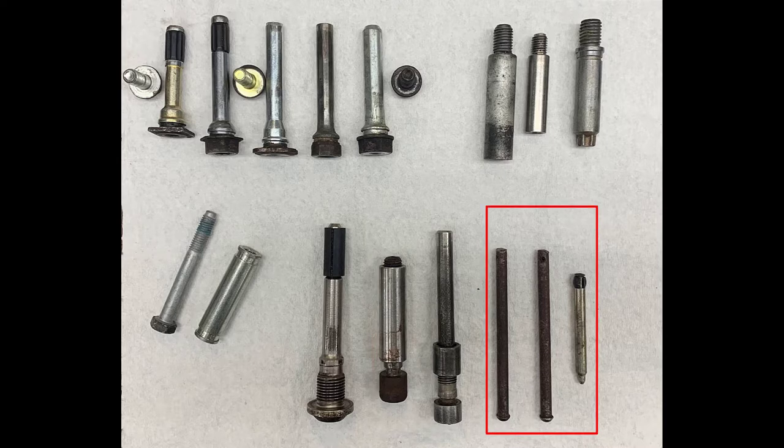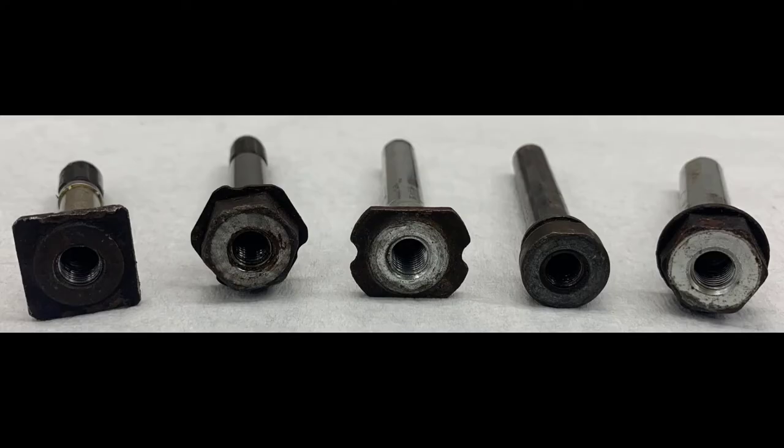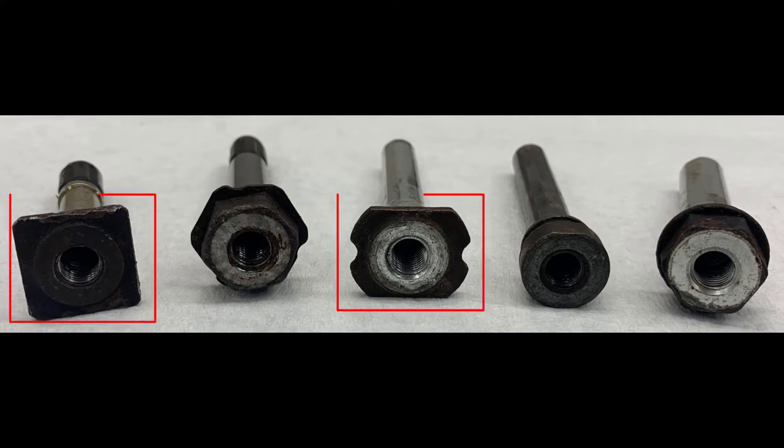These three are for fixed calipers and really technically aren't slide pins. You can see by the shape of my slide pin that it's important to get the correct orientation — the one on the left is square and the one on the right is a rectangle shape. The orientation of that slide pin when you bolt it back together is really, really important.